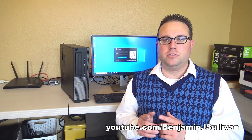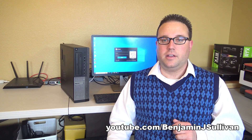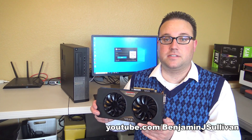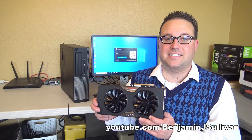In fact, most of today's newer games don't even work on onboard video — you have to have a physical card. Now, if you go online shopping for a video card, you'll see that there are so many different kinds to choose from. However, most of them are big and bulky because they're designed to fit inside full-size desktop cases, also known as ATX cases.